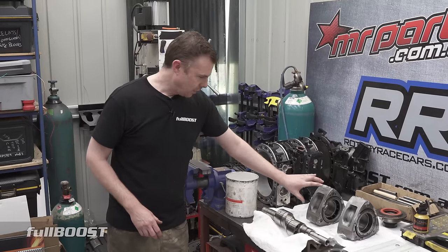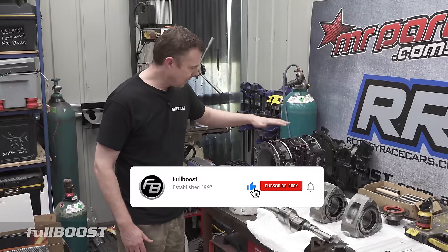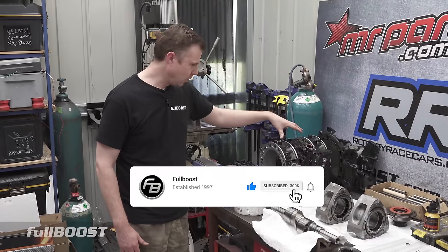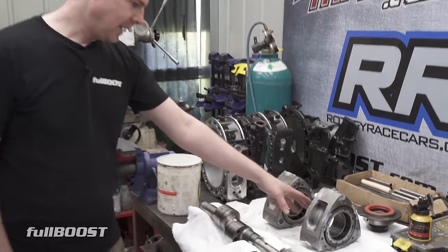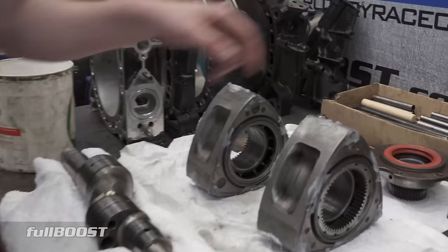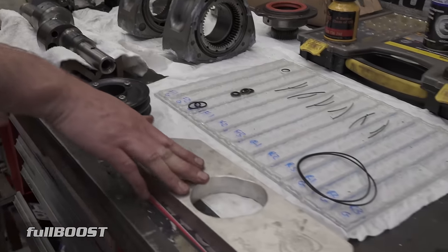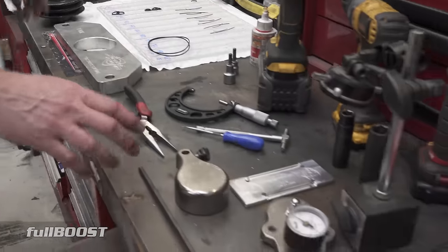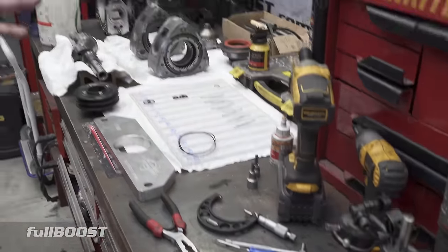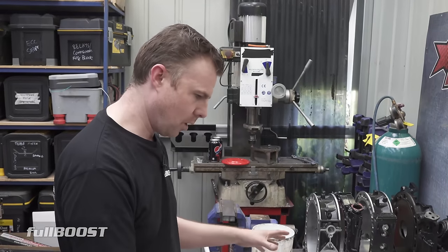Such as machining these rotors and the assembly of the rotors, prepping, porting and painting of all the engine components, measuring the journals and the crank as well as inside the rotors and the stationary gears. We've got to make sure we set top dead center timing. And then we've got a whole heap of tools here which you may or may not have seen before. So what we're going to do is, first of all before we get building the engine, run over some of these tools that we use and how we get to the point right here.